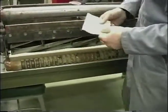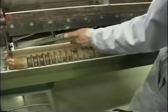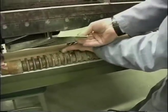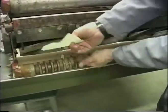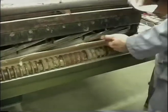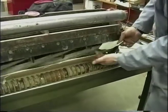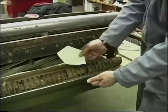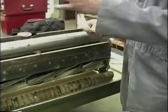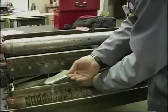So that's where I'm going to stick the paper in. I'm going to stick the paper in at 90 degrees, and I'm going to spin the reel. And the idea is not that we get super high speed to cut the paper. We want slow speed, and we want to cut. If you get the paper curled up like this when you're spinning it, it's going to rub it and not cut it, which is because you're putting it in there wrong.